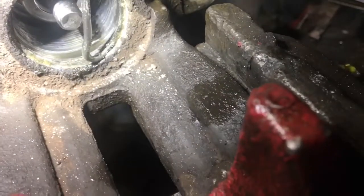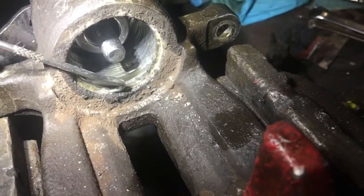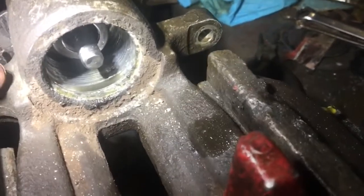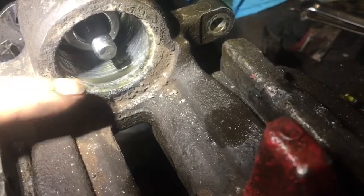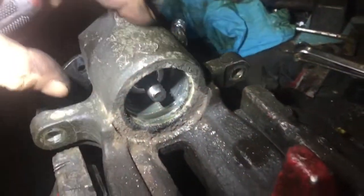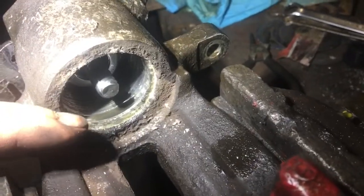We'll just inspect the ridges of the tracks. You can see there's a good bit of oxidation. I'm going to clean all of this out because this is aluminium and as it oxidizes it creates this dirt, and what happens is it pushes inwards, the seals start binding, and then the piston is sticking — not seized, just sticking — so it's not sliding in and out and you have bad brakes. I'm going to clean this up and then put new seals in.